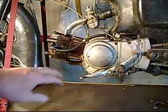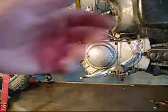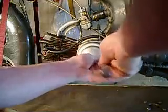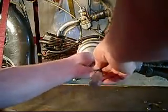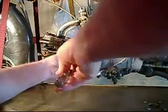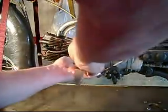Now, what we're going to do is we're going to change out the points. So the points are under this cover. Okay. So we're going to reach over here. Probably get in the way. Take this off. Now the points are not in here. I've already taken them out. And what we did is we let the customer go on the internet and hunt down a set of points and condensers. Okay, that's where they go.